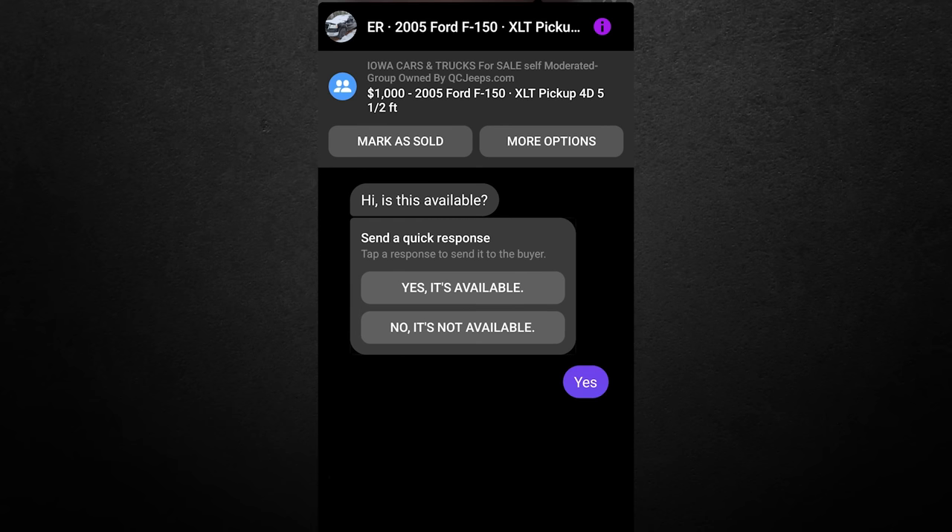I found it — it's way over here! Holy crap. Meanwhile, inside the truck, that right there is a coil driver for a relay, which means — aha — a broken relay. I wonder if I can twist these two wires together to make it go. New relay is in. I've got a crank but no start. I believe the inertia switch is literally on this fender right where the car hit, so there's a good chance that probably went off and disabled our fuel pump. I'm going to find that. Oh yep, it was tripped. Try it now, sir.